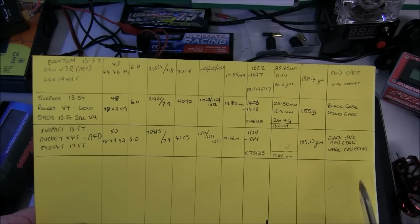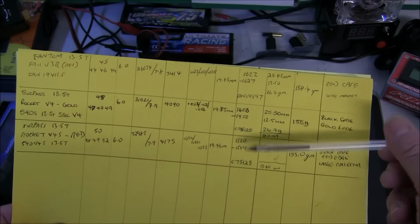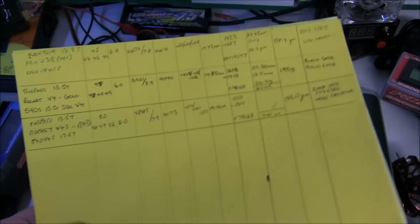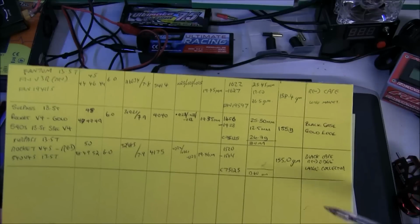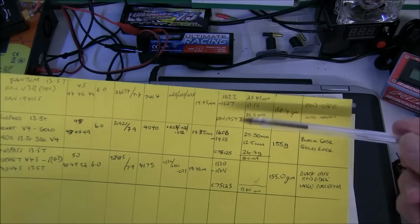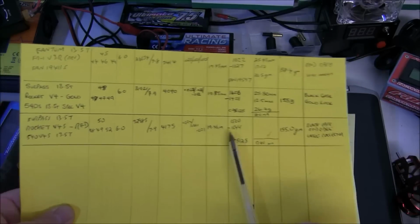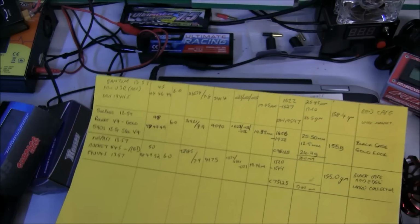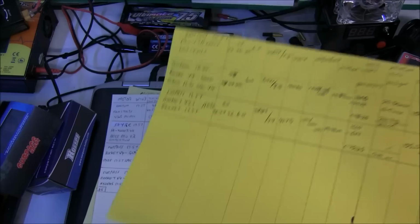Again, the only negative is variation in rotor strength. They're obviously not matching them up. In the factory, they're just taking them and putting them in. On the track, will you notice? Well, maybe a tiny bit, but I don't think anyone's going to notice. It's not as if they're weak. They're all good strength rotors. You need 1450 to around 1500 or over. That one's going to be really torquey. I doubt if you'll notice any difference, and I don't think you need to go through any to select them out because they all come up good.